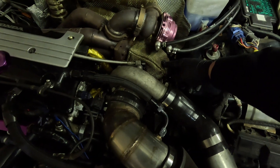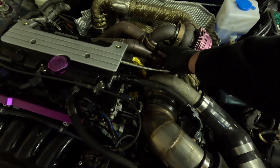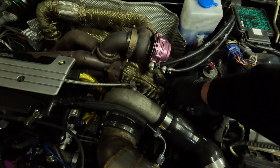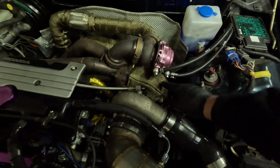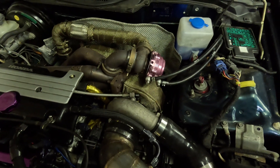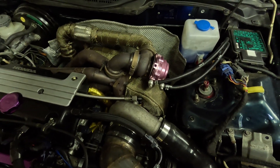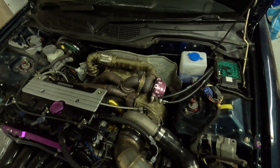It seems to be the best way to control boost, so I think we're going to chop this, weld that up, leave that capped, and weld that straight to the exhaust housing. It should help. I'm not going to say it's going to be perfect because we're on a 45mm gate, and a lot of the lads in America run 60s on them and they don't seem to creep. So it's more of an experiment, but if the 45mm gate doesn't work, we'll go to a 60.